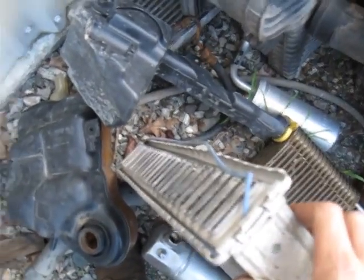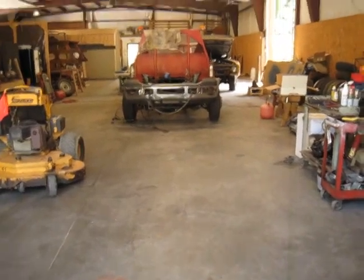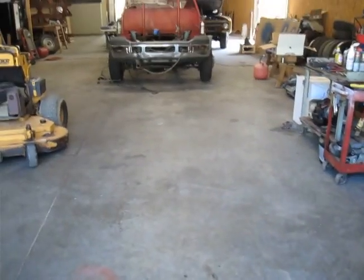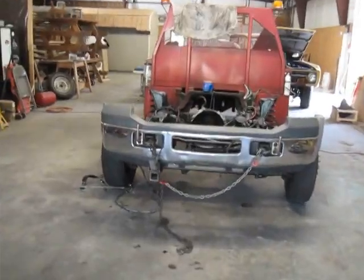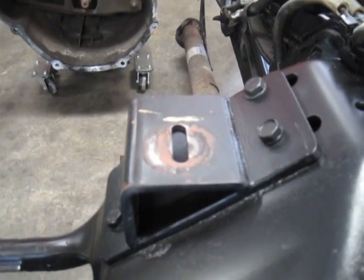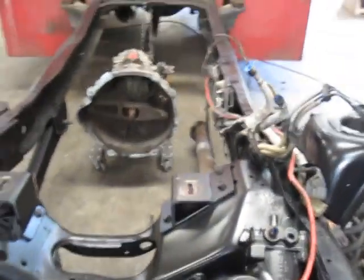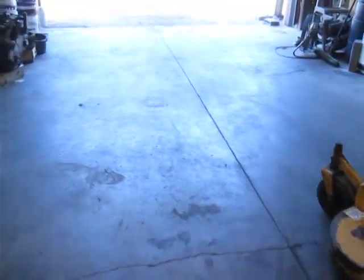You can see here I blew the intake side off of it. One tip when you do the 12-valve Cummins swap in these trucks, especially if you use the Diesel Conversion kit: the motor mounts are adjustable — there are three different locations you can put it in. In the forward location you can't run the factory Dodge cooling fan due to clearance issues with the radiator. The frame-side mounts are slotted so you can position the motor pretty much wherever you want. I'm using the central location so I do not have to cut and weld on my transmission crossmember, and it gives me just enough clearance to still run the stock cooling fan.